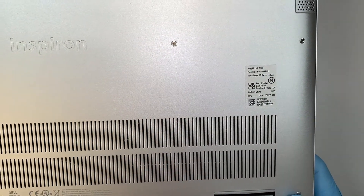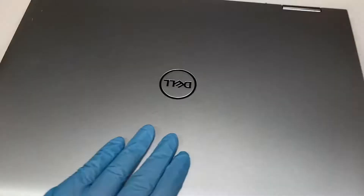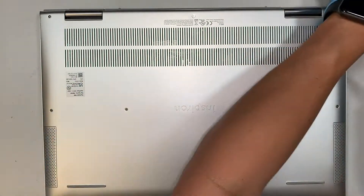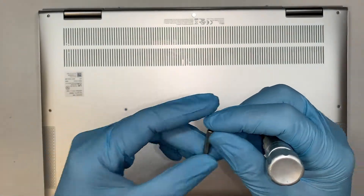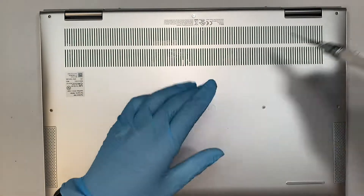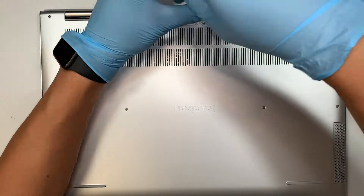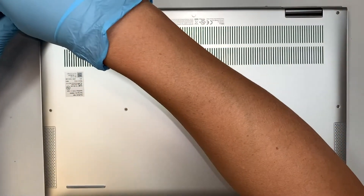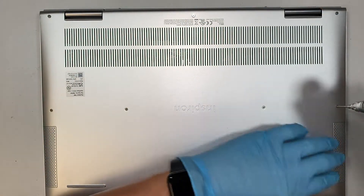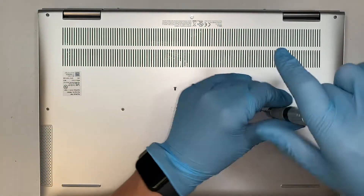So in this video I'll do a complete teardown or disassemble the laptop, and during that time I'll show you what things you can upgrade — maybe the RAM, changing out your battery, maybe upgrading your M.2 drive or hard drive. So turn it around. The first thing we want to do is to remove the back cover. Get yourself a Phillips screwdriver — I'll be using the PH000, the tiny little Phillips screwdriver. The top three screws do not come off, so you just unscrew them and make them loose. The rest will come out.